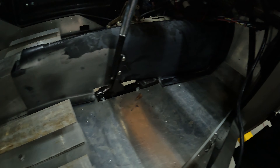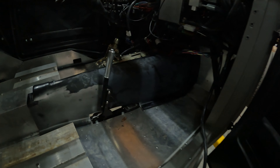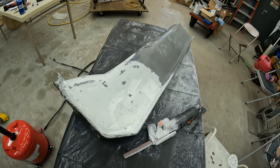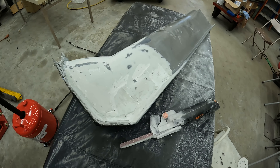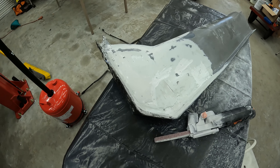There's a boot that goes with this which should cover up most of that gap, and then I can seal in the rest. Now that all the holes are cut, everything is ready to go. I'll be adding the carbon fiber to the two pieces - you saw me earlier sanding down that other one. There are a few rough spots but it's more or less ready to have the carbon fiber blanket put over the top, epoxied in. The epoxy will fill in most of the little holes and we should get a nice flat surface. This part is by the feet all the way under the dashboard, so if it's a little messy, I don't think anybody's going to notice.